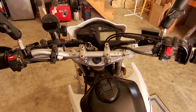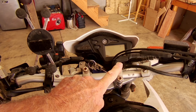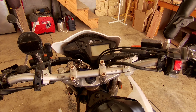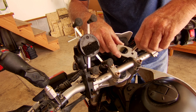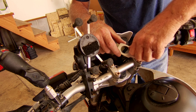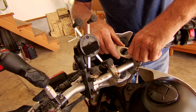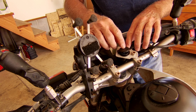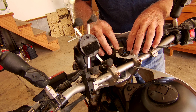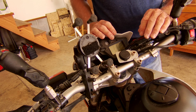One of the problems with this bike is it's got a cramped area up here. There's not a whole lot of room to mount anything like this. So what I've decided to do is mount my bracket right here, and it'll project out this way, and I'll be able to plug in right there. The wires will go down and around the back. Let's put that bracket on there and see what it looks like. I've picked this spot right here. If I put the bracket at a little bit of an angle here, it doesn't interfere with my screen or my ability to get to the key. Right there — it's got a little waterproof cover. It also has an illuminated face and a switch on it, so you can turn the illumination off at night or if you want to save battery power. Right there, I think it'll work.